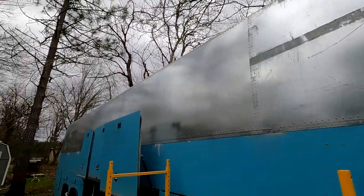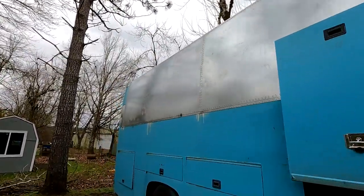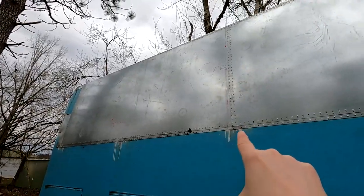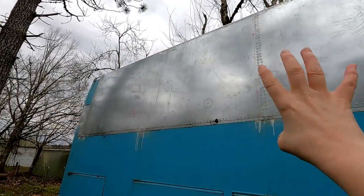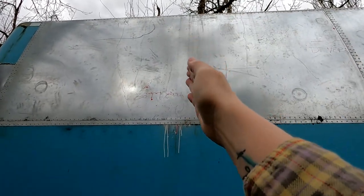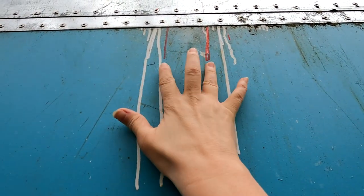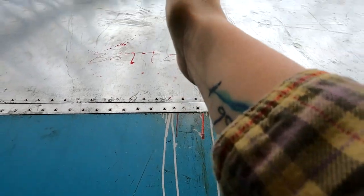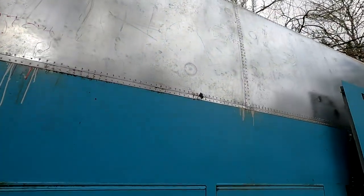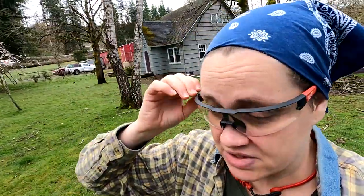All of the sheet metal is in and fully riveted. Back here you'll see a row of rivets and rivets all the way around this piece — it's about 11 feet. On the inside of the bus there's a rib we've marked, and eventually we're going to put one row of rivets all the way up on each of those ribs for stability, because we're going to be putting in windows and 11 feet is a long way without anything riveted in between.